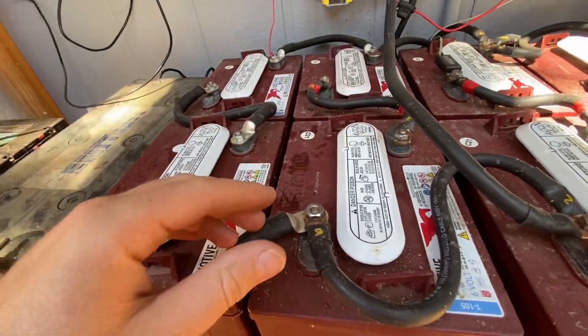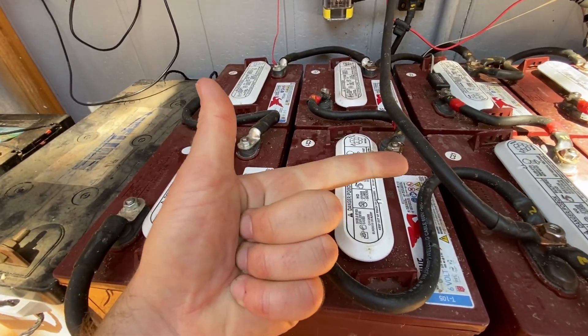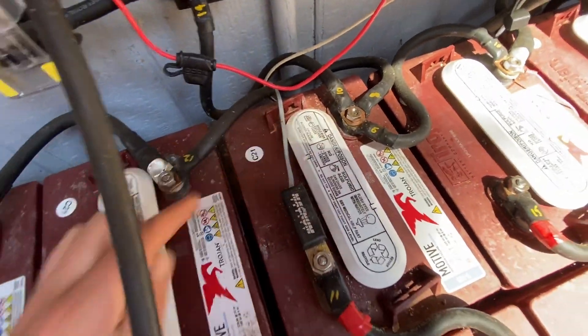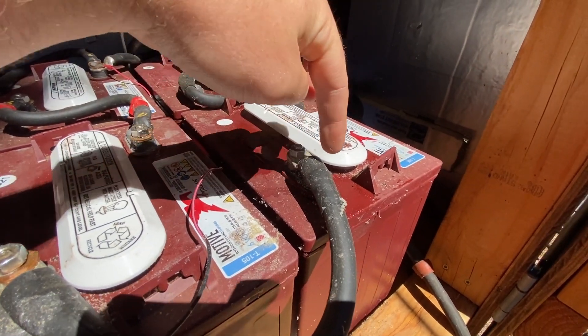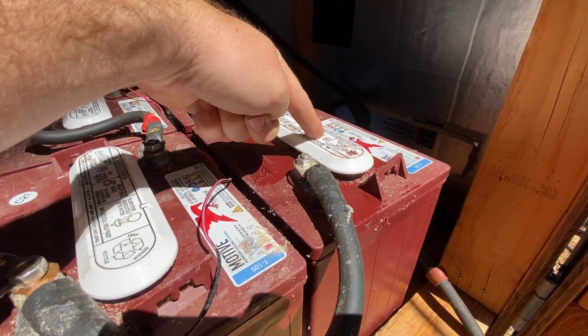All right, now that we've got things relatively cleaned up, take a look at things. You're wanting to look for any corrosion, any spillage, just anything that might look wrong. Over here there's a little bit of corrosion at that terminal, and a little bit here, but really those terminals don't look bad to me. If you do have corrosion on your battery terminals, you can use hot water and baking soda — just pour it right over the top of the terminals and it should eat up that white growth. Over here I do have some sort of an issue where it looks like the battery's been spilling over, and I'm not quite sure what the deal is with that yet, but we will revisit this.